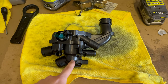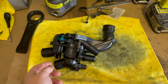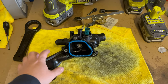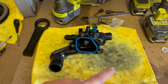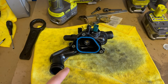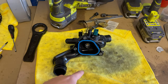How we found out that this was the problem: the car threw code P0597, and also one of my friends does aircon recharge - he recharges the AC gas in the car - but the AC pump didn't kick in because the thermostat cut it off. That's how we figured out this has to be replaced. Also, the Peugeot has another fault, an intermittent fault P0299, which shows as underboost. Basically, there is the wastegate and there is the flap which closes it, and that flap is loose so it lets air escape - that's why it has underboost issues, but that's probably going to be in another video.